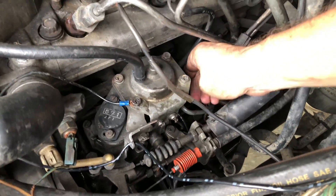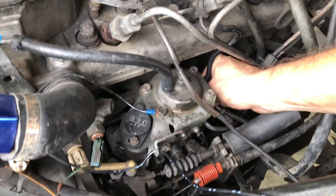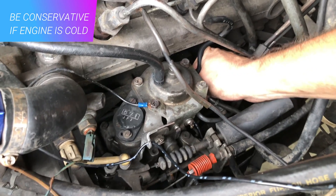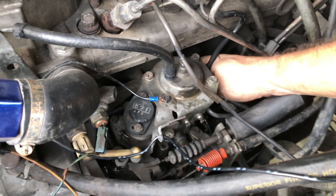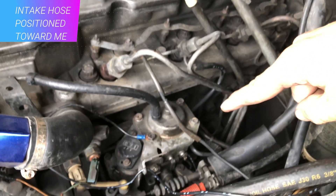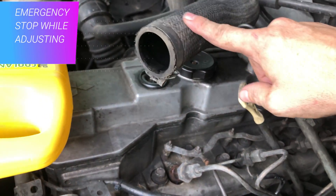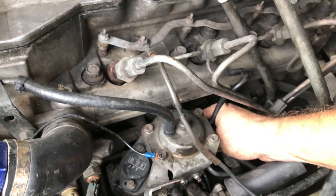Yes! While we're here I'm going to adjust that fuel load screw. We've got a really low idle right now — that means I can pretty safely turn this up. The engine's cold obviously. I can't get too carried away. That's about probably where I was — I'm gonna back that off a bit. Before I had the intake manifold off, if the engine ran away while I'm adjusting the fuel load screw I could cover the intake manifold and stop the engine. That way it can't get away from me. I think for now I'm going to leave it there.